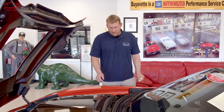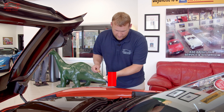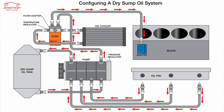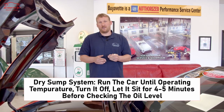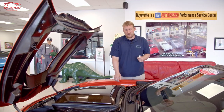On the dry sump, you're not going to check this oil like you would a wet sump with the engine off. Because if we pull the dipstick now with this engine cold, you're going to see that it's barely touching the stick. That does not mean add oil — there's a specific process. What happens is the oil that's in the engine will drain back to the oil pan and the pump doesn't have a chance to return it to the dry sump tank. Therefore the tank is going to register low on oil. If you were to add oil to fill it up, you're going to overfill the oil system. So what we have to do is start the car, run it till it gets up to operating temperature, turn it off, let it sit for four to five minutes, and then we'll check the oil again — that's the actual level of the system. Once the vehicle has reached operating temperature of 175 to 180 degrees, we'll turn it off, let it sit for five minutes, and then check the oil.